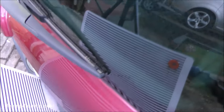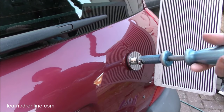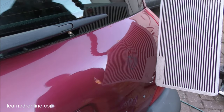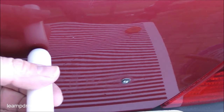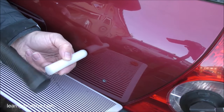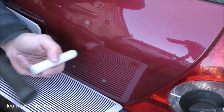I'm going to continue trying to use the glue to see how much more I can pull out, but there's a good chance we're going to have to release some of that tension before the metal starts to flow. I apply a little bit of heat then use my slide hammer, but this time it didn't really release much pressure. So we're going to use a tap down - this has a leather tip, it's from Cro-Carb, and it is brilliant for removing soft highs such as crowns. I'm working that crown, gently tapping down those high spots, which releases tension into the area directly above, allowing the metal to flow so that the next glue pull will hopefully give me a little bit more.